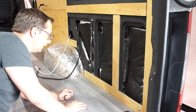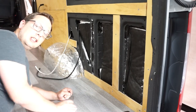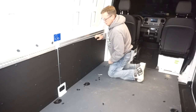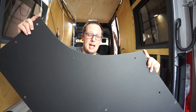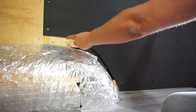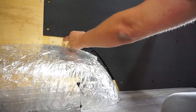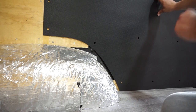Let's get back to it. To finish this video we need to fill this spot in with our paneling. One of the spots I really debated when planning the van was cutting around the wheel wells. Our van when we purchased it came with all this black paneling inside the van. Although it was a pain to disassemble, it's coming in as a positive now because it has the wheel well arches cut into it as halfway points. When you take these plastic pieces and put them in they don't actually fit the wheel well because we have a floor in here, but it does give you the right arch angle, and then we just shrink that down by whatever that measurement is.